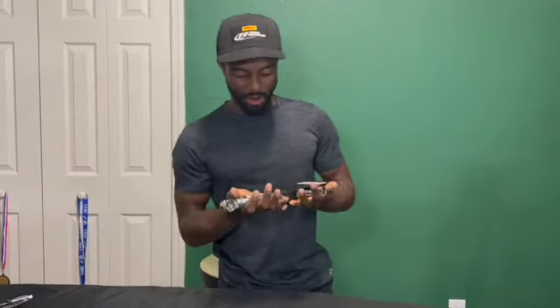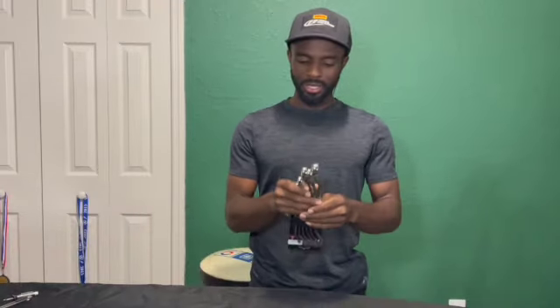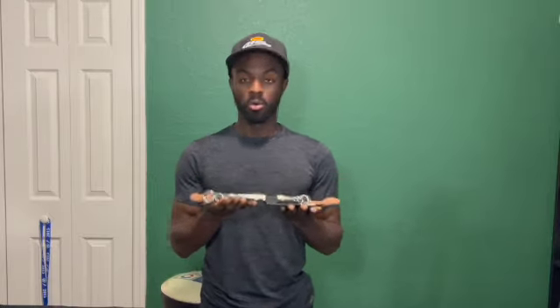So let's start with the first one, which is very common but comes in different variations. I'm going to go through three variations. So here you have your regular wrenches — these are basic. You could get these, but they don't really get a lot done because of the angle they have. This is for when you're working directly on the front end of the engine or underneath, and they can get into tight spaces but not very tight spaces due to angle limitations. So you're not going to use these much unless something is directly in front of you.